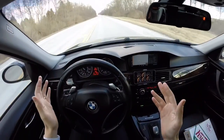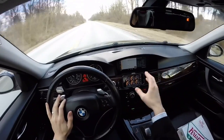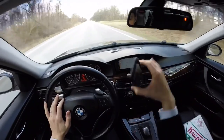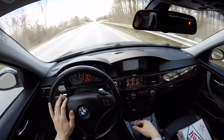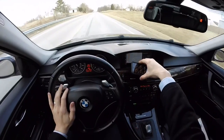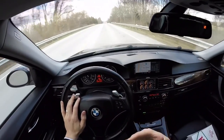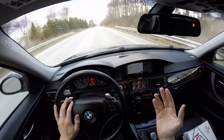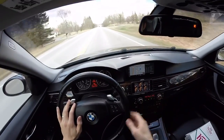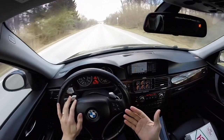As far as data logging goes, all you have to do is go into the app. I'm using the Bluetooth connection with this nice vent clip right here, with the JB4 app running. To get a really nice data log, you can go at all different speeds — through third gear, through fourth, whatever the case — which just gives you more data. If you have a nice run, you can get everything you need.